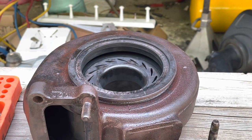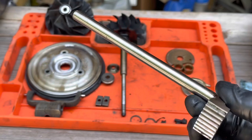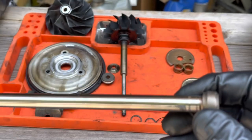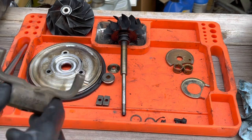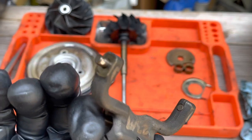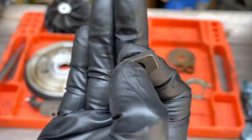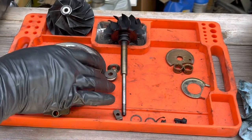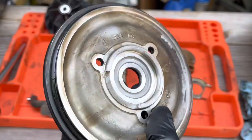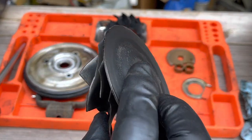We're going to get everything wiped down and inspect it. The VGT actuator bore has slight witness marks from the seal but we're looking for any deep gouges - this one is just fine. The VGT paw - we look for any wear on the actual pins and we don't see any. The front housing - look inside where the oil deflector is and make sure surfaces aren't gouged or scratched. The compressor wheel looks good but we'll probably end up replacing it.